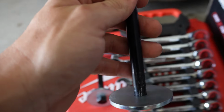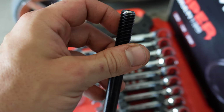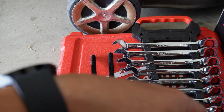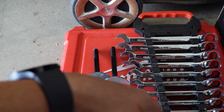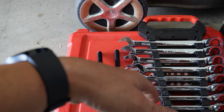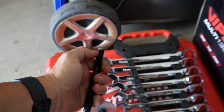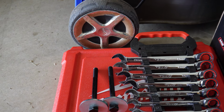These are the bolts that I was talking about that you've got to get through the bar, and as you can see, it's just destroying the tip of the bolt itself, trying to thread it in. So I don't know if the pitch of these bolts doesn't match up with the internal thread on that pin, or what the go is there. Even when it was out of the car, I tried to thread it into that hole just to make sure they were the actual right bolts, and it struggled to thread itself onto the pin. So it just makes it a heap harder when it's already on the car. So yeah, I'm gonna have to get a die set and just touch up them threads a little bit so they're as they should be, so I can actually thread it in.